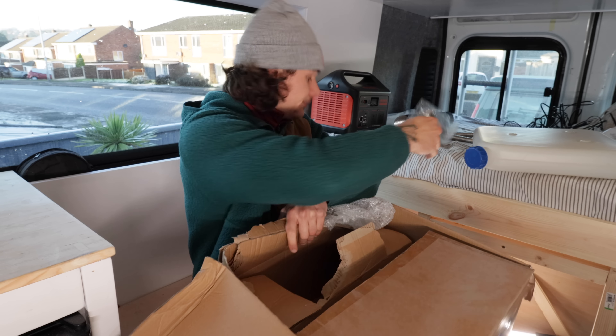But I think they smell a bit and they can leak and you have to refill them. So I'm just going to plug it straight into the diesel tank of my van. Exhaust pipe, pipe for the heat outlet, baffle for the exhaust to stop it sounding like a flipping F1 circuit when you try to keep warm. Air inlet pipe for the air inlet underneath the van, because it is an engine — the diesel heater is. That's all it is, just a mini engine that warms a core that then blows air through it using electric. It's basically a radiator on steroids. And then the badger itself — the diesel heater. There she is. And I think that's a five kilowatt one. Beefy.